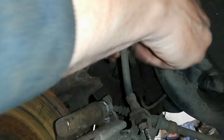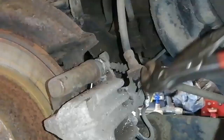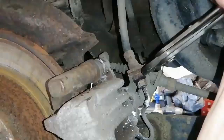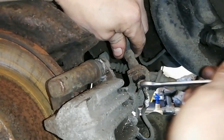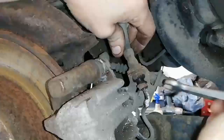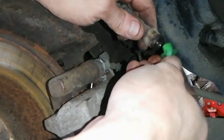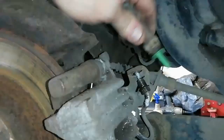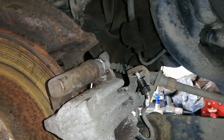We need to clamp this brake hose before we go any further. Okay, remove the clip. We're going to take the nut off now — it's going to come nasty for us — and we'll put a gob stopper in the brake hose. There we go, set it out. I have a 13mm spanner — you can't see it — it's on the handbrake linkage.